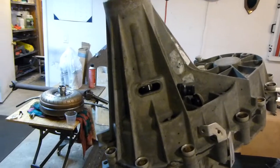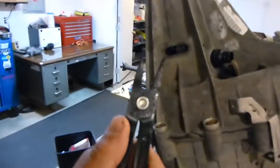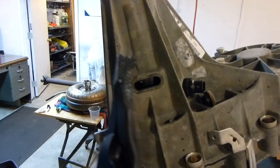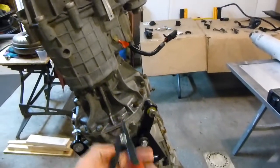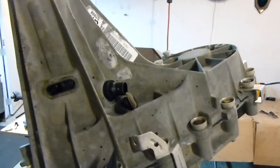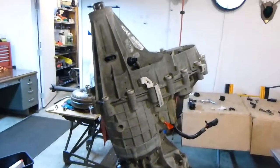Merchant actually has a very nice install video which I'll be following — they show you how to do this pretty easily. First step: there's a snap ring in here, you need a nice pair of lock ring pliers. You can kind of see they have ribbed and fat ends — they're for these style lock rings that are going to be all through this transmission. Then we pop the sensor out, undo our bolts, crack the case apart, and go from there.